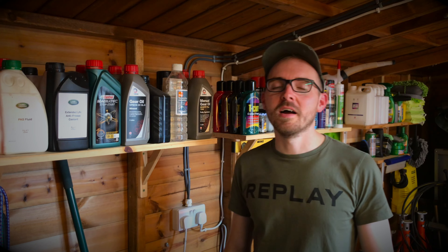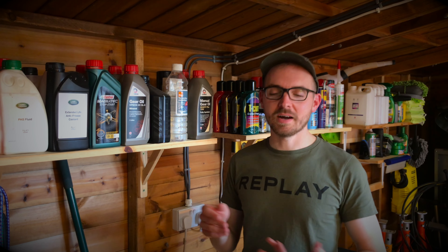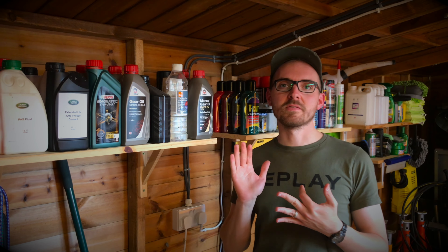Unfortunately Ben's car, the Freelander 2 XS, is going to be off the road for some time. Unfortunately the PCV valve or oil breather has clogged up — it should have been changed, it was on the list to do, and we didn't get to it in time. As a result it's blown the rear crankshaft seal, which is unfortunate because Ben had already changed that. We didn't do a video on it as it would have been a very long video — taking the gearbox out, putting a new clutch in, et cetera. So that's gone.